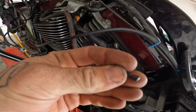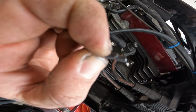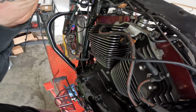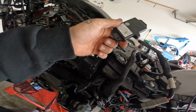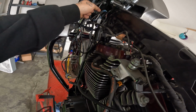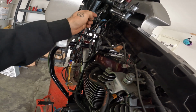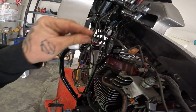All right guys, check it out. Can you see that? Probably not very good. This is a piece of heat shrink with 2 wires on that side, 1 wire on that side, and a little teeny tiny bump where the wire was exposed between the two. It got sharp. Let me explain what that was. This little garage door opener, security system, whatever it is, was ran into here, and it was butt connected, and I hate butt connectors. So I took it out, soldered it, and I must have had a sharp joint still on my solder connection.